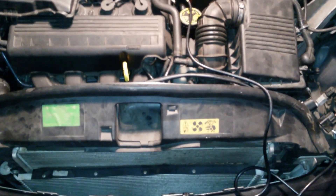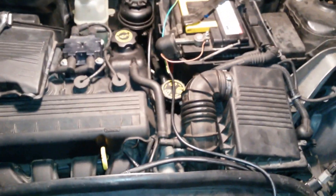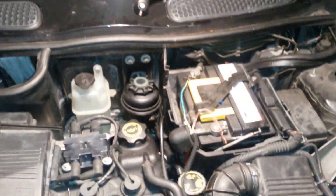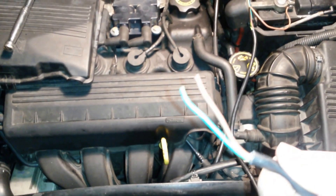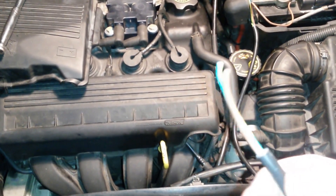So this is how I tested my radiator fan on my 2002 R50 Mini. I've just got an old power cable which I've spliced the ends off, connected one side up to the battery, and the other side I've left the wire shroud on so it doesn't arc with anything.